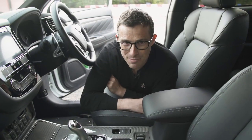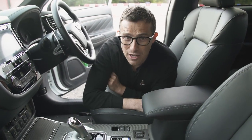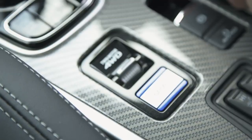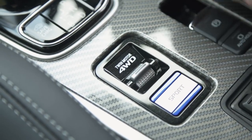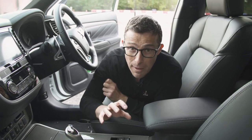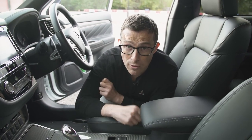Because this car has electric motors at the front and back, you can go off-roading under electric power alone, which is quite unique. There are three different settings for the four-wheel drive system: normal, a snow setting for added grip, and four-wheel drive lock where the same amount of power goes to the front and rear wheels.